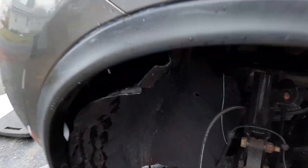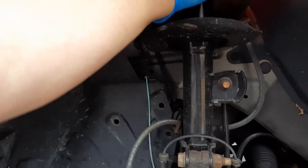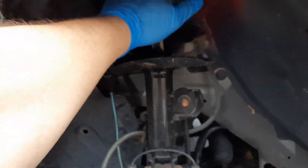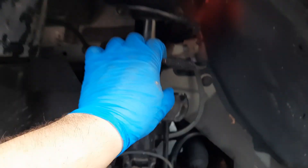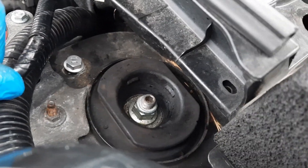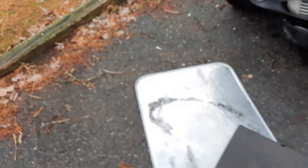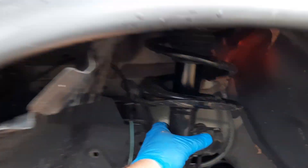It's a Juke thing. These are springs — aftermarket — because I've bent a couple and broken two on the right side already just from torque. I did it once before I was tuned and then again after. These are McPherson strut — FPS is the name of the company. They were cheap, already loaded, and they've got an Allen key in the center so they're adjustable. I've been on these about eight months and so far so good. I get wheel hop — typical Juke wheel hop — from time to time, but other than that they've been holding up great. Cheapest ones, but so far the strongest.